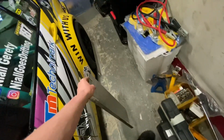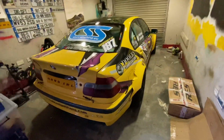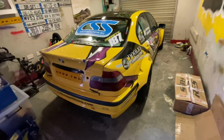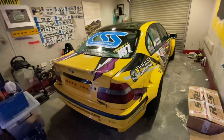And yeah, so basically put one plate on the wheel there and the other plate on the other side and take our measurements. How accurate they are, I don't know. You can let me know in the comments. But it's just a bit of peace of mind that if we do run into trouble, I have measurements. Because as you know, the car has been tracked at Nally's Tyre Centre and we've tested it and we know it's good. So at least we got them plates and we have the measurements now before it goes to work. And if anything happens, we have the measurements, we can put our toe plates back on, measure it all up again and make adjustments if we need to.